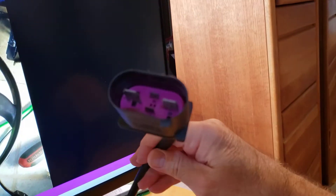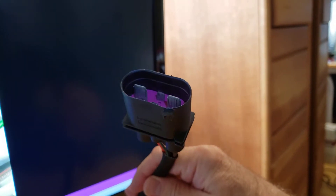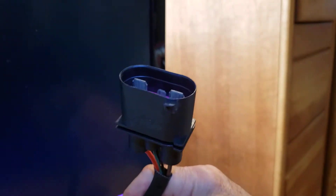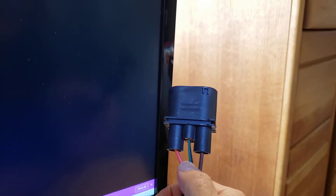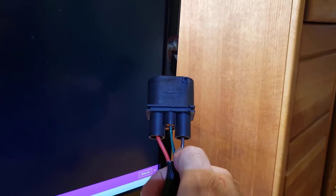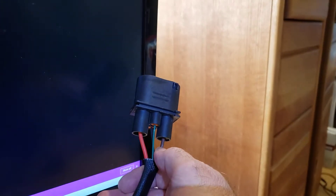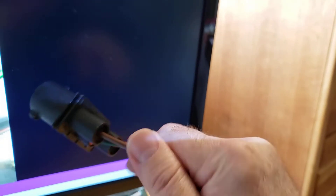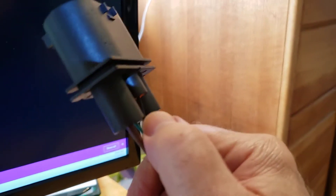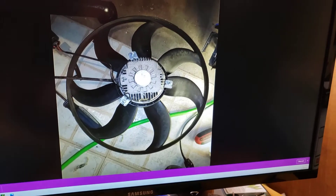This is the end connector for it. This connector is available at the bottom of the radiator, and I'll show you a video later. It has basically four wires coming to it: a little green wire, a big red wire, a big brown wire. In the original connector, this big wire here — I think it's red with black stripes, but here it happens to be brown in this connector. And on the other side, we have a small black wire. That connector is called J293 in wiring diagrams.